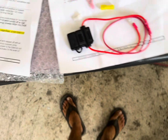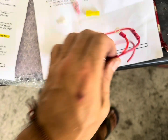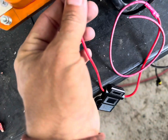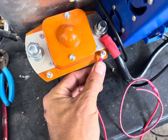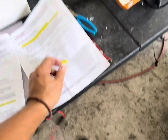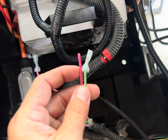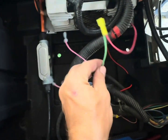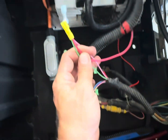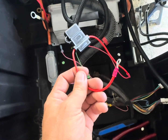On this one you have to install the run/tow switch bypass — this gets a little bit confusing, but this will go on this side of the solenoid, and then this will get spliced in with the provided green spade connector into this green wire. These will go on my run/tow switch and this will go to the right side of the solenoid's small terminal.